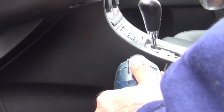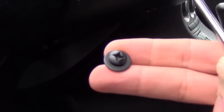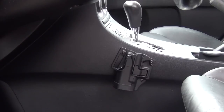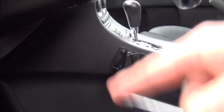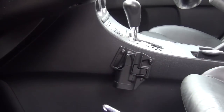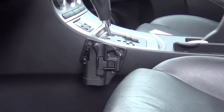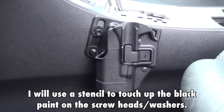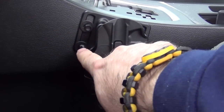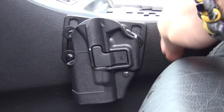Now I'm just going to drill a couple of pilot holes, then take the screws and washers — which I've painted matte black — and screw them in. Once started, I put it in position and tighten it down. I recommend using manual screwdrivers rather than a drill, because when screwing into plastic you really don't want to over-tighten — you'll lose your grip and strip it out easily. But with good hard plastic like this and heavy-grade screws, you'll have a solid hold as long as you don't over-tighten. It is now installed. I did have to add a screw at the bottom to make it more stable, and I switched to hex-nut tops on one screw where I couldn't get a screwdriver in.